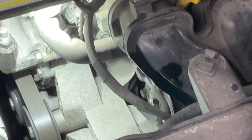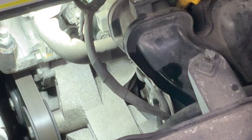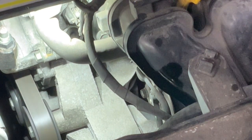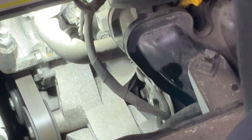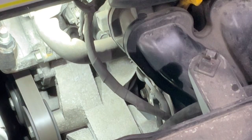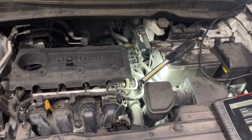Let's go in and open and close this thing, see if the computer can control it, high voltage, and be able to ground the circuit. And yes. Okay, so the solenoid is popping off and on there. There we go. So it's cycling the solenoid. All right, so the solenoid and the vacuum switch and the ability of the computer to control that is 100%.